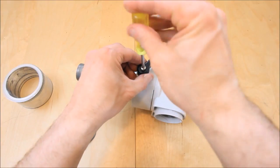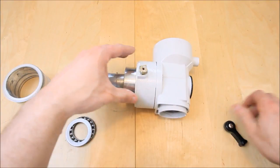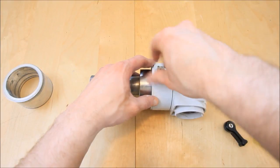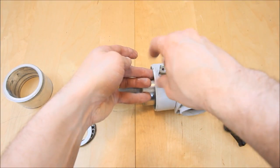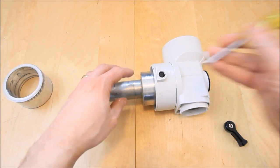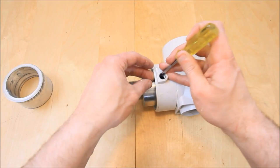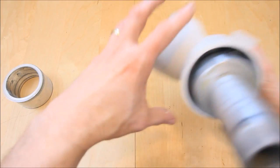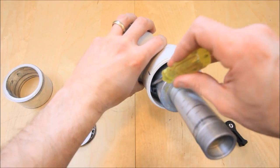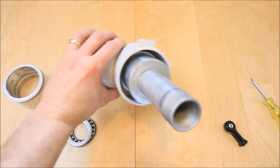Move the clutch lock-down screw, then remove the brass lock. You may be lucky and the plunger might still be there. If it's dislodged, get a screwdriver and push it out, or use a set of tweezers. If it gets stuck, carefully slide it out. There you go — that is everything removed.